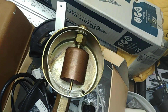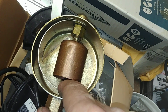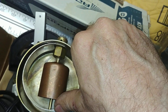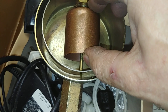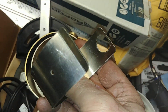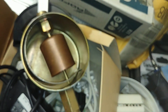Let me show you what's inside. It's a bimetallic strip — two different layers of, I think, ferronickel alloys — and they expand and contract at different rates, sandwiched together. As it heats, this will bend up and shove a pin up into the hole. When it rattles, that's what you're seeing. If it doesn't rattle, that means the pin has gotten stuck out of the hole. In an earlier video I explained what happened to this one: the bimetallic strip at the factory was put in backwards. If you look inside and can make out the words 'TruFlex,' that's probably why it's not shutting off in the presence of steam.